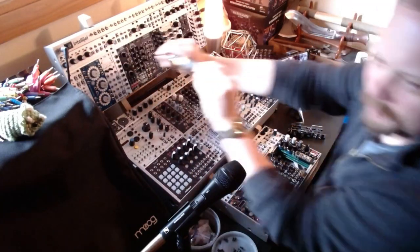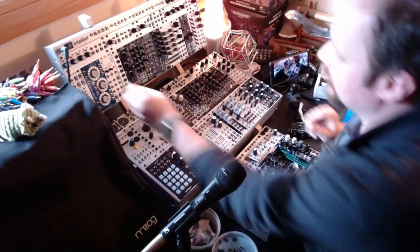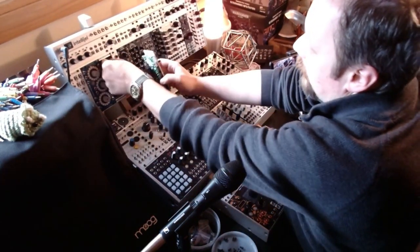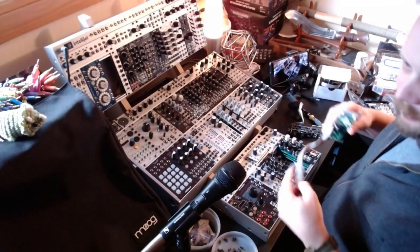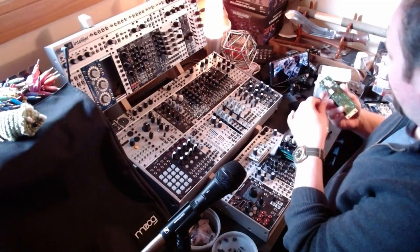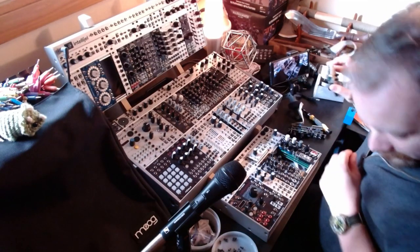The power in both of the performance cases is mounted along the top edge of the case, which means you really have to fish around in there to plug things in. Having a flying bus cable makes accessing the power connections just a lot easier and a lot cleaner. I know someone is going to say it — that I should probably have some ESD protection while doing this. And you're absolutely right. I don't have a grounding strap at home, unfortunately, so we're just being careful — I'm not wearing wool socks or anything, and doing my best not to wheel my chair around.